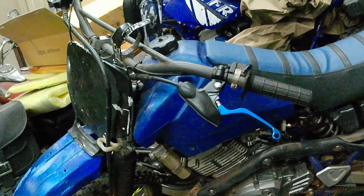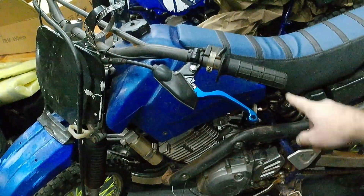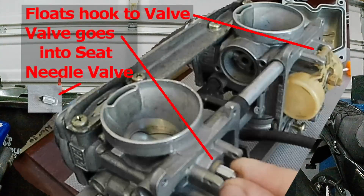Actually, bigger engines are easier — they're less sensitive usually to small leaks. It's called a petcock. Where the fuel goes into the carburetor, there's a needle valve. It basically just lets gas into the bowl of the carburetor and then shuts it off. They need a bit of gas there for the Venturi effect to pull fuel up into the engine, so it has to have a bowl of gas. But you can't be overfilling that bowl or it'll leak out everywhere. The floats judge the level of the fluid in the bowl and automatically open and close that valve.